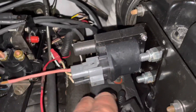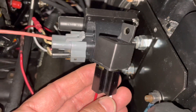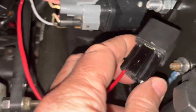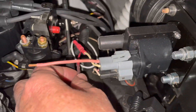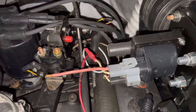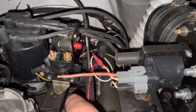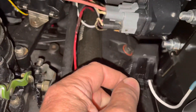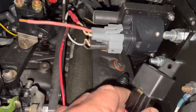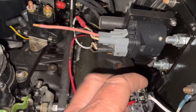I've already wired up this relay partially. The white wire here is coming off terminal 85 and that goes to ground — that's my ground connection. The red wire is on terminal 86, and that is a wire I butt spliced into — it's really the extension of the purple wire at the back of the motor. That's the original purple positive that was on the original ignition coil, and I butt spliced it to come over here and turn this relay on. So when you turn the key on, the purple wire will be energized at 12 volts and that will turn on this relay and turn on your ignition system. Terminal 30 is right here by my finger on the bottom.